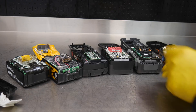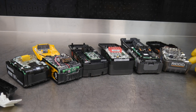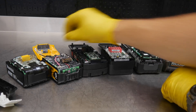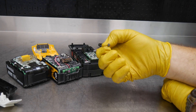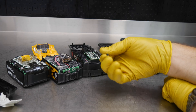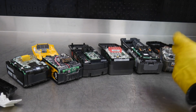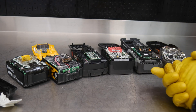We've got the caps off all of them. As I mentioned, all of these are 5 amp hour batteries with the exception of the 6 amp hour Octane Rigid battery. They're all T10 fasteners as far as what it took to take them loose. Some of them had the pin in the middle, which is a security Torx or T10H — there are different names for it, but basically it's a security Torx. It has a little pin in the middle, so your bit needs to have a hole in the center of it. So we've got these batteries apart — let's take a look inside and see what type of cells we get.